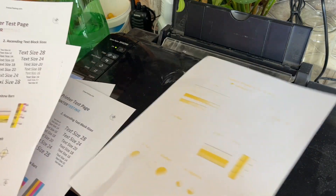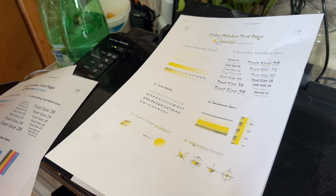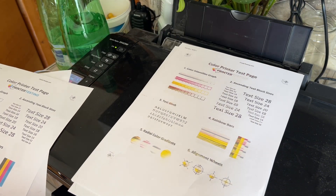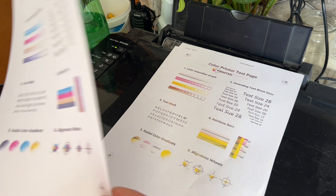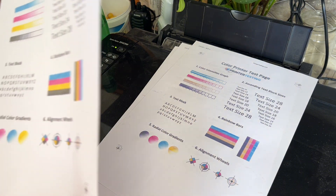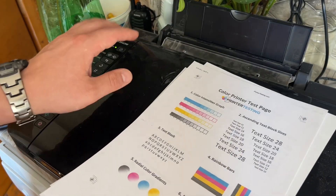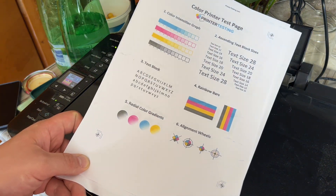Let's give you a recap of what happened: when we started the printer I did a nozzle check, then printed again after the first soak up, after the soak up with a little alcohol in the nozzle, and then after the check again after the head cleaning cycle. That's how you can unclog your Epson printer. I hope this video has been helpful to you, and I'll see you in the next one — bye bye!